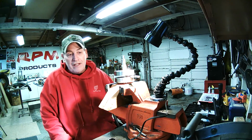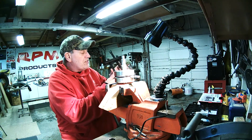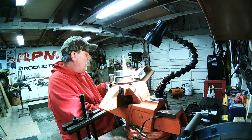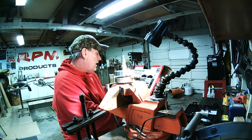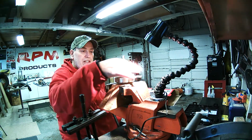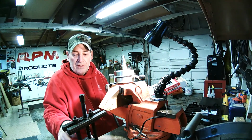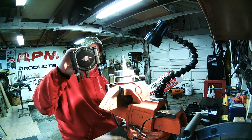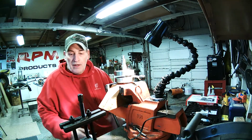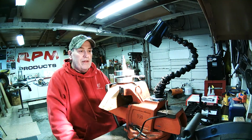So there you go. Get yourself a Harbor Freight gear puller. It doesn't have a specific size, I don't think. It says it's for pulling gears from 9/32 to 3-inch diameter, so that's pretty much any kind of crankshaft you're going to use. You obviously don't want the inside hole too small, and this one isn't too big either, but it works good. It was worth every penny. If I never use it again, it made life easier, right?